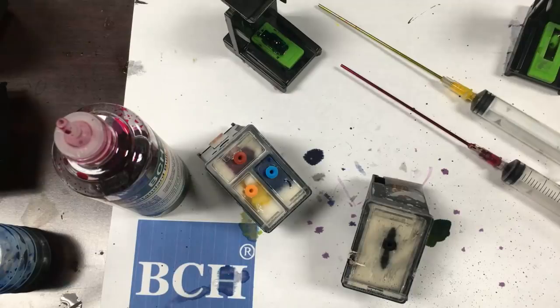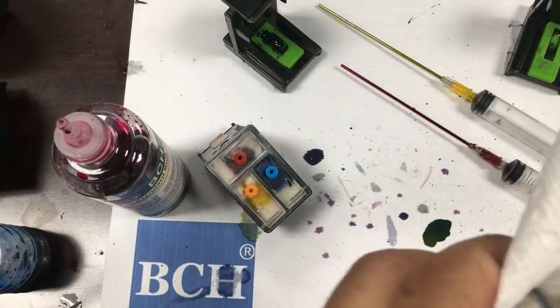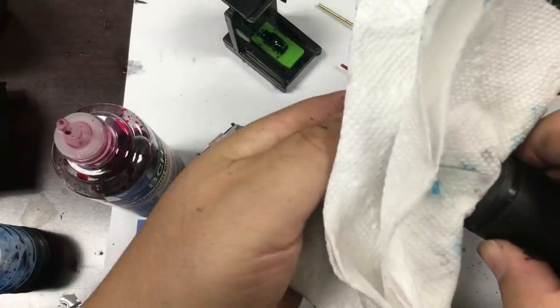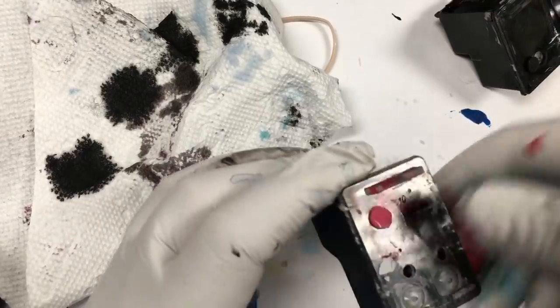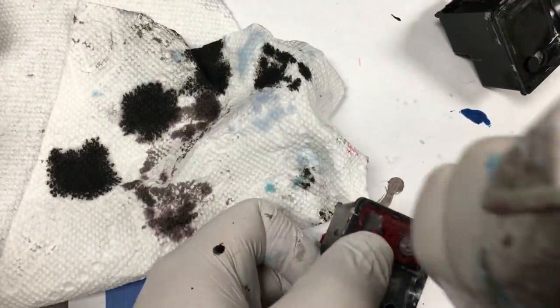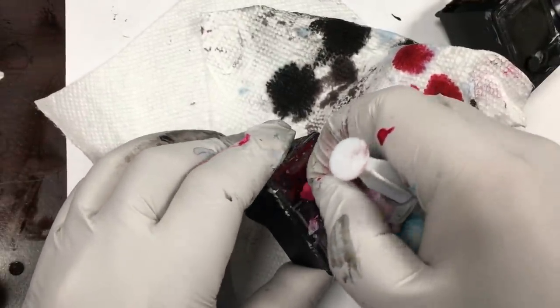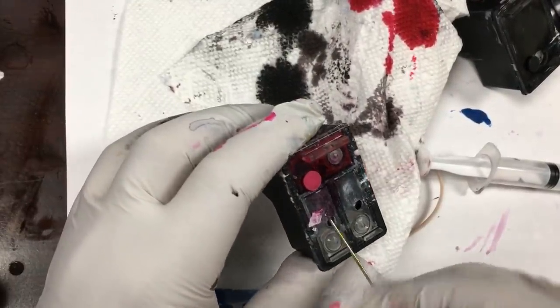I know not everybody has a priming clip. If you don't have one, here's an alternative: get a piece of paper towel, wet it with water, then get a vacuum cleaner and suck underneath. Once it's unclogged, you're going to see lots of ink coming out. Besides those two methods, you're just sucking from the bottom. Because you get this thing airtight, you can blow one mil of air from the air hole and keep the refill hole plugged. After blowing, the air pressure inside is higher, so you need to unplug the refill hole and release the air.